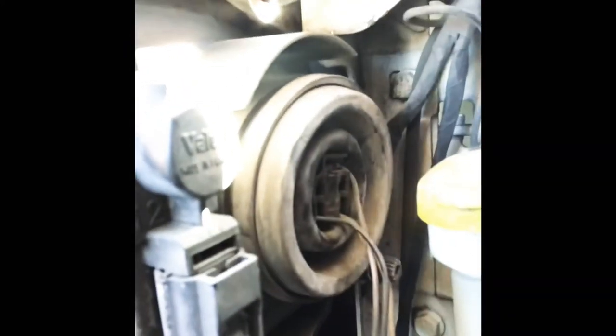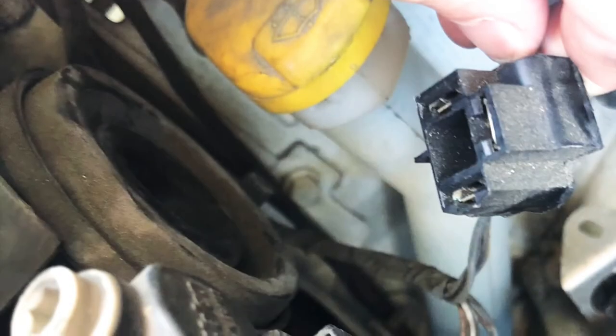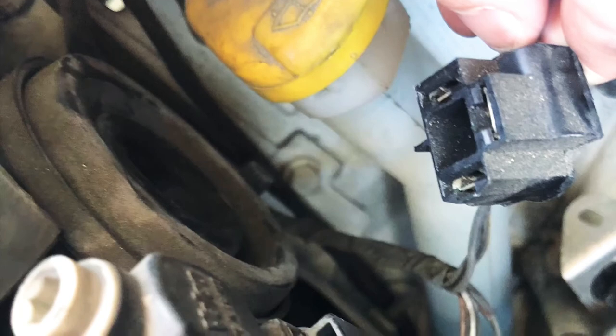It's quite hard to film this but you get the idea. I'll show you the inside and the actual headlight surround itself. There you've got the rubber protective surround with the actual plug. Hard to video removing the plug but it's simply a pull and a little bit of a wiggle. Here we remove the protective rubber surround which stops dirt and grime getting into the headlight. As you can see it's fairly straightforward — so here you can see the actual bulb and surround itself.